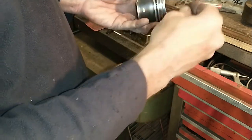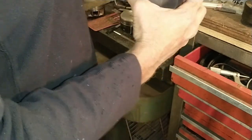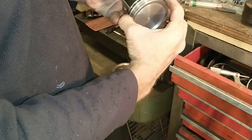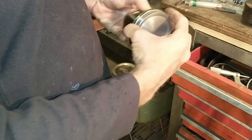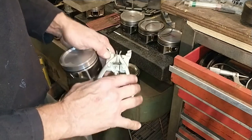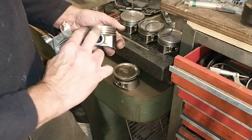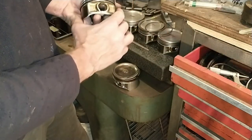This is what I was talking about — spiraling the rings on. I've been spiraling rings on since I was about 12 years old. Every book I read — ASE and every other engine building book — tells you to use the ring expander, but my problem with the ring expander is I've never broken a ring spiraling them on this way. I've watched a lot of students break rings with the ring expander. It has to open so far, and then they still end up dragging the two openings of the ring over the lands of the piston.